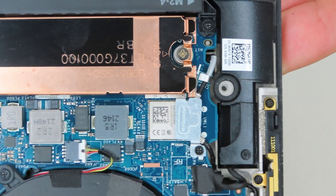Lastly, I want to wrap up by pointing out a major issue with both machines — Dell decided to solder the Wi-Fi directly to the motherboard. If it fails, you really have to replace the whole motherboard, as resoldering would likely cost even more. I think it's a poor design decision, but that's how they're making them now and there's nothing we can do. All right, guys — thank you very much for watching and we'll see you in the next video.